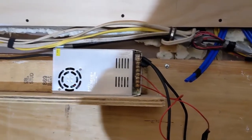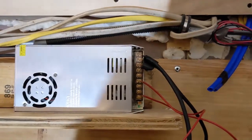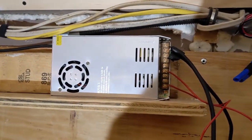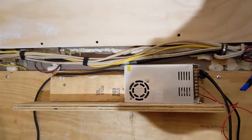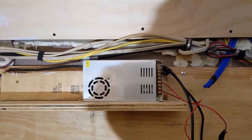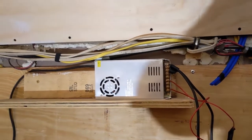Looking all the way around, we've got all the panels up and the wires pulled through except for the ones I couldn't grab. In preparation for the temporary wiring of the LEDs, I've got this DC power supply — I believe a 10-amp supply that converts 110V to DC. I mounted it on a makeshift shelf temporarily to keep it out of the way. I'm going to wire a 12-volt bus as the permanent solution — a 12-volt line running front to back on a fuse — and also mount my fuse panel temporarily right here.